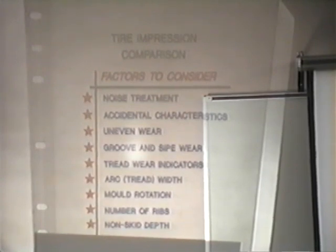You estimate it first visually and then set it at what you think. You put it in, set a little bit higher, and when you go down to the bottom, if that's not quite touching, you knock off a 32nd of an inch down to 9, and you go down and it's just touching, so you can make a note, 9/32 of an inch. You seize a tire a week later, take the tread depth, it's the right pattern, everything, take the tread depth reading, happens to be 3/32 of an inch, you know it can't be the tire. Because at the scene, it was 9/32 of an inch.